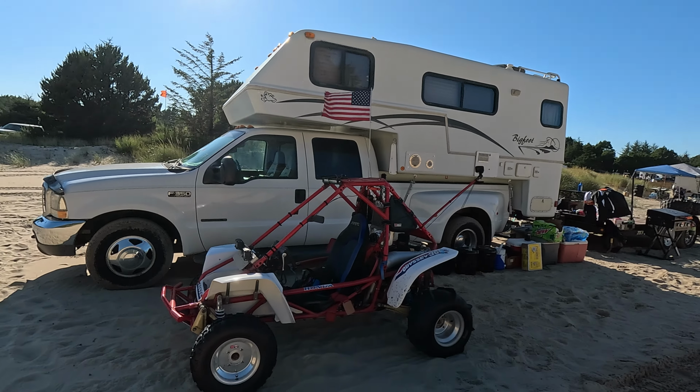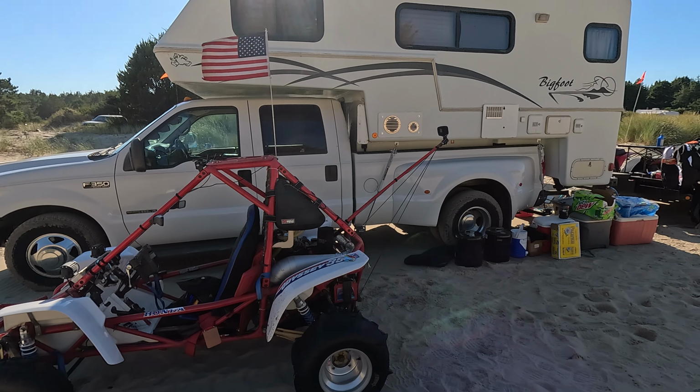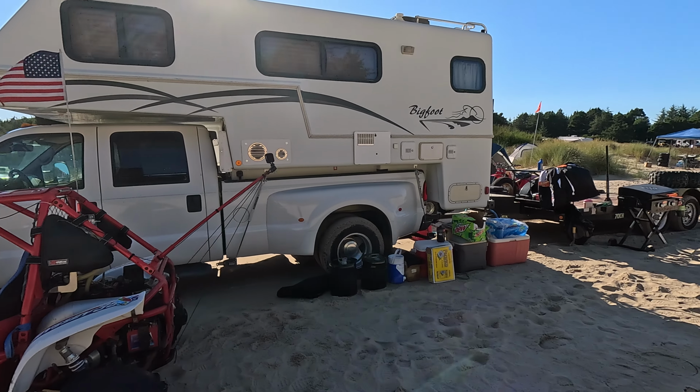One thing is, if you are running low on gas, you got to watch your EGTs. I have an EGT gauge, so I was able to make sure I didn't lean out, but it was really, really close. I was able to get about 3/4 of the way back, and then the guys that I'm with went out and got some fuel and brought it back. But overall, the 350's dialed in, working really good. Camper's doing good and all that sort of stuff.